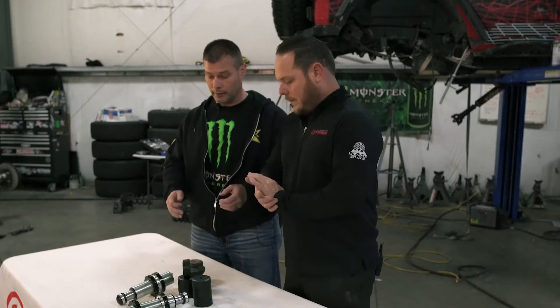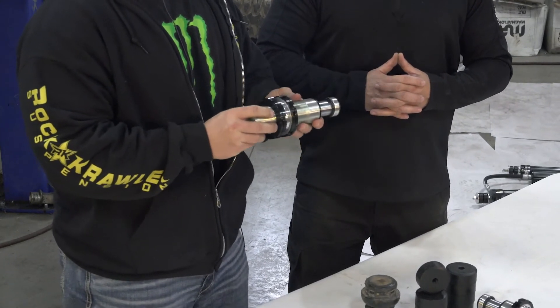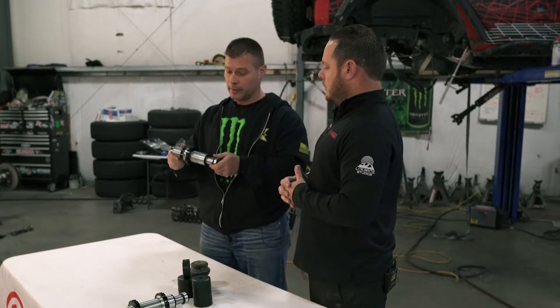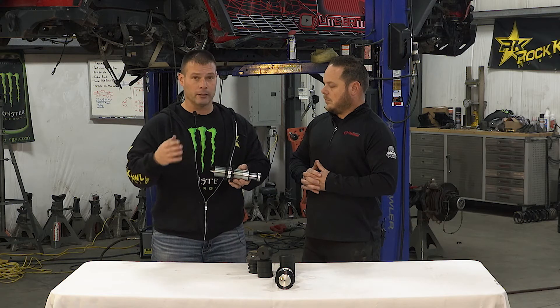Another option to control hard bottoming of your vehicle is what's called an air bump. You can vary the pressure in the chamber to create greater force, which slows your vehicle down — same as the denser foam did, but with more control. These come in various sizes. What we have here is a Radflow 2.0 with an inch and a half stroke. They vary the stroke and the size of the can — the bigger the can, up to a two and a half inch, the greater bump stop capacity you get. Setting these up is also a critical component of your overall suspension setup.